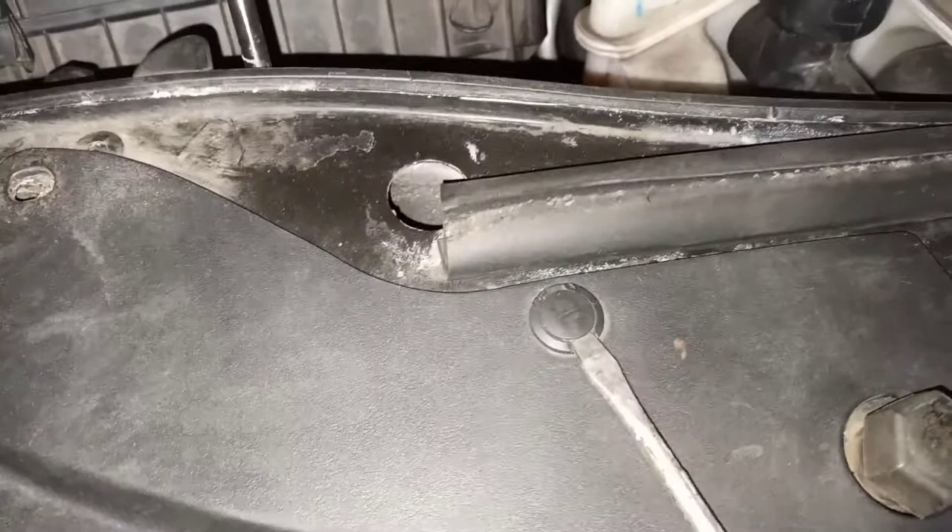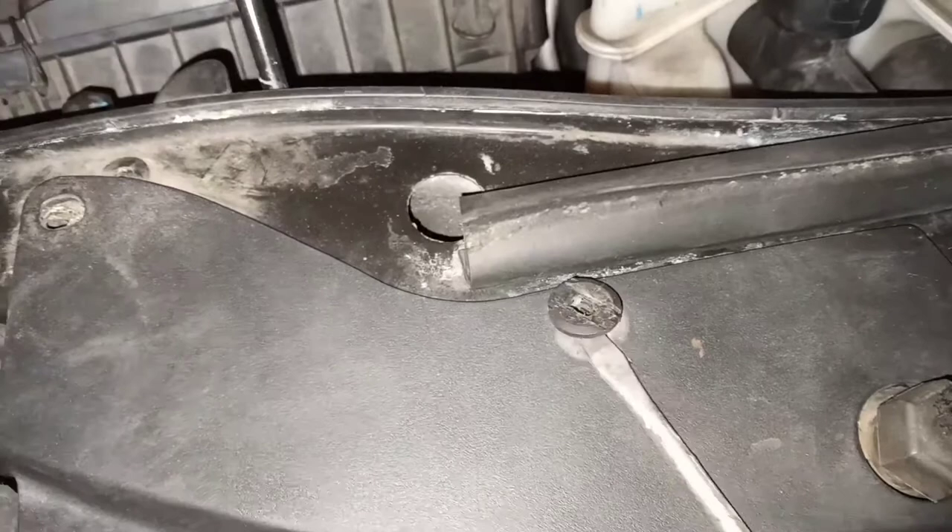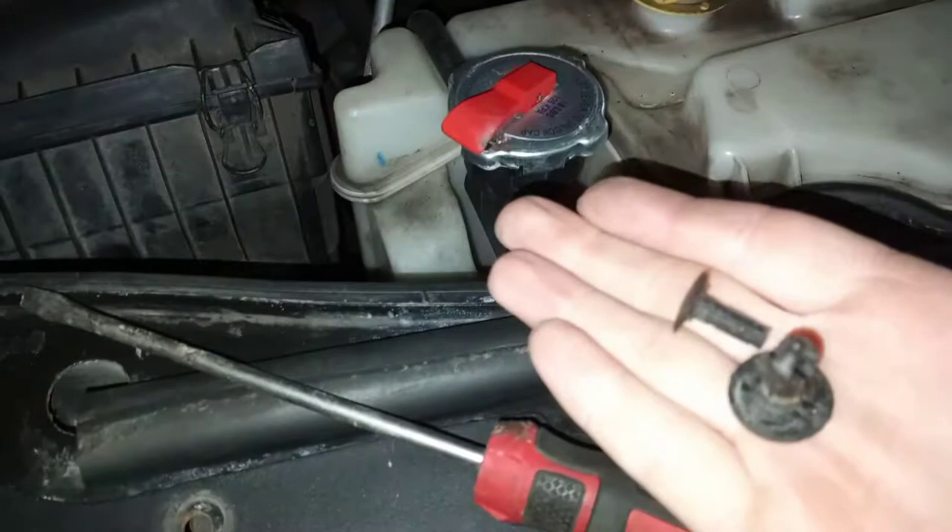To take the grille off, you have to pop off these little pins. The way I do it, I just use a flathead screwdriver — get in underneath it, turn the screwdriver, and you pop it up like this. I always pull this part out and then get underneath it to get the other part out as well. Try not to lose it. There is a little tool with two little prongs that makes it easier, but I've always just used a screwdriver.